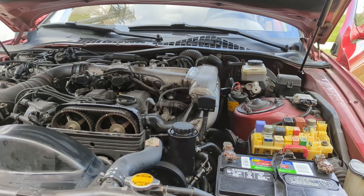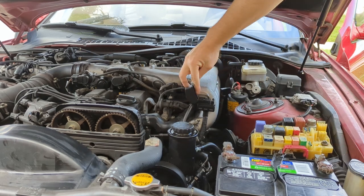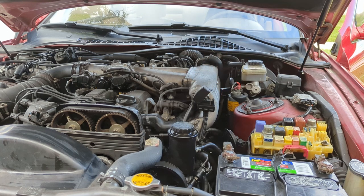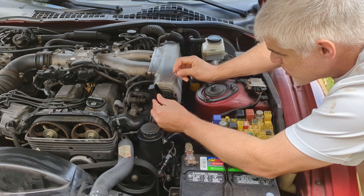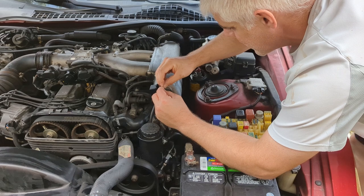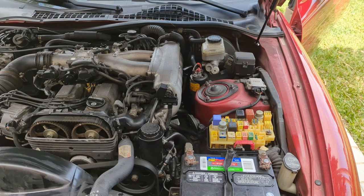All right, so the service manual actually talks about shorting out two pins on here to activate the fuel pump. I believe it's on the left side, the top left and bottom left, but let me just double check. All right, so stupid me. I was double checking the pinouts, but they're actually listed inside the cap. So I'm shorting out FP to B positive, B plus, which is battery positive. So let's see what happens. And I think if this allows it to run, that tells us something.